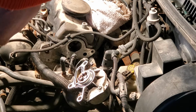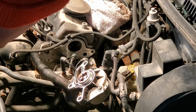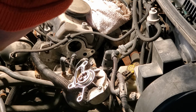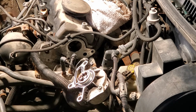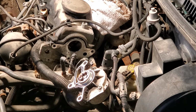Technically, to make a really good seal, you want it to be clean and dry. But most neoprene seals, you put a little film of oil on them. Could check what the manual says, but I think we're going to put it together dry, give it the best chance of making a seal as we can. It's not very warm, I wish it was warmer, but not much I can do about that. I do need to look up the torque specification for it though.